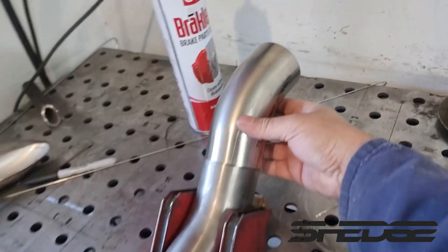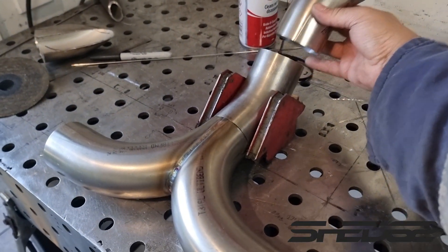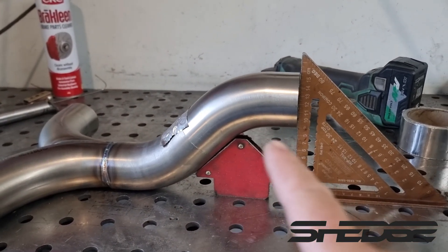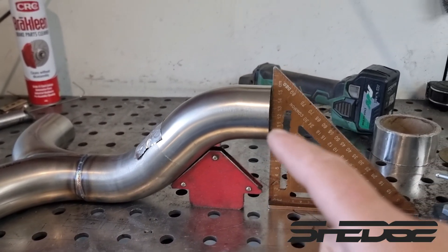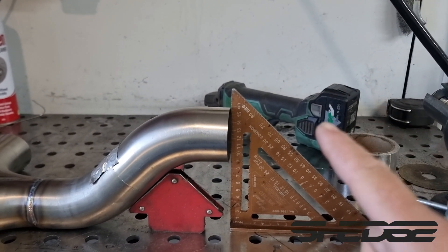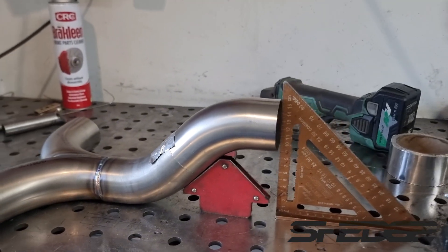What we're going to do now is add a couple of 45s, so it's going to sit something like this, and then another 90 off that end there up to the turbo downpipe. So let's see how it all plays out. We're going to add this next 45 to clear the bearing hanger down here, and then we have a 90 coming off the back of the turbo and then another 90 into there. In theory it should be pretty close.